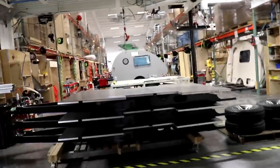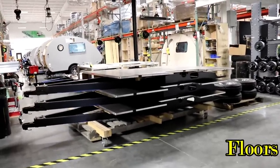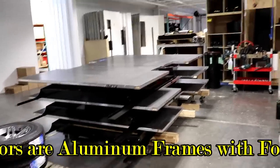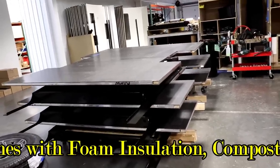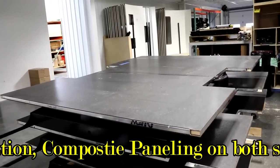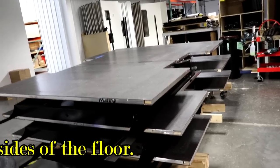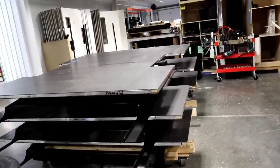So the TAB 320 line, a line of its own. As you can see, they set it up here where they're going to start with the frame, putting the floor and attaching that to the frame itself. You can see they have the axles down here, the tires and so forth. One thing I want to point out about the floor for the TAB 320, because it is unlike some of the others on the market — they're using composite paneling on both sides of the aluminum frame construction for the floor. In between the aluminum, you're going to have insulation, so you actually have some insulation properties. They also put in the wood in the framing, so that when they're screwing things to the floor, it has something to bite on.